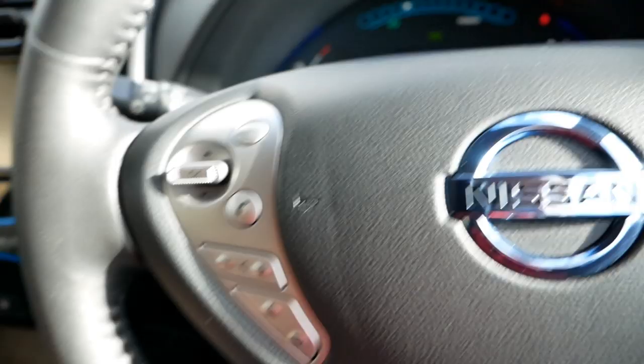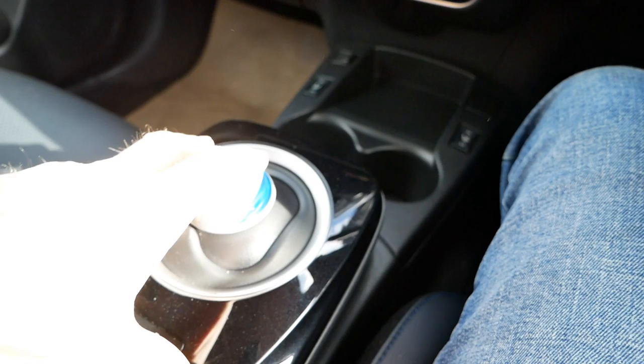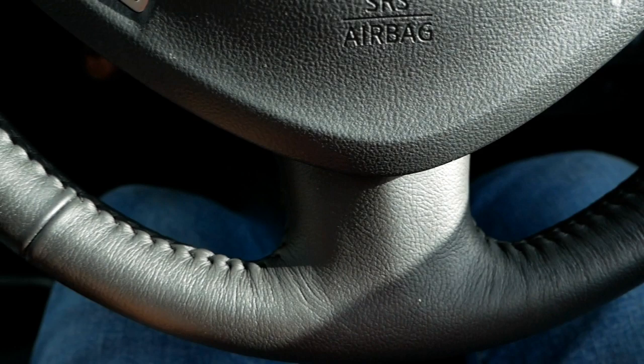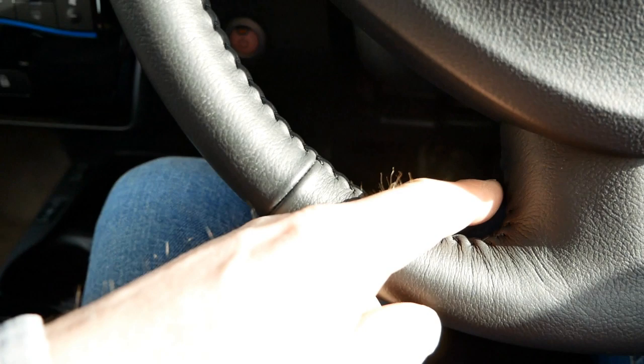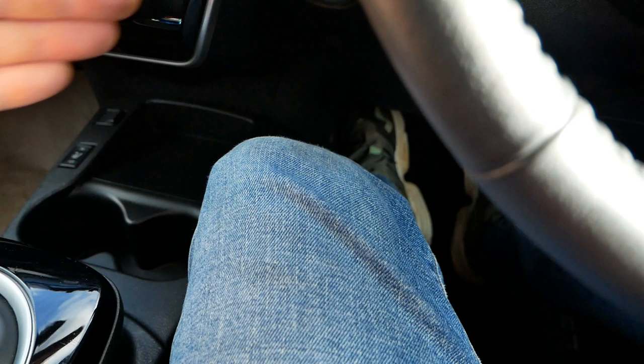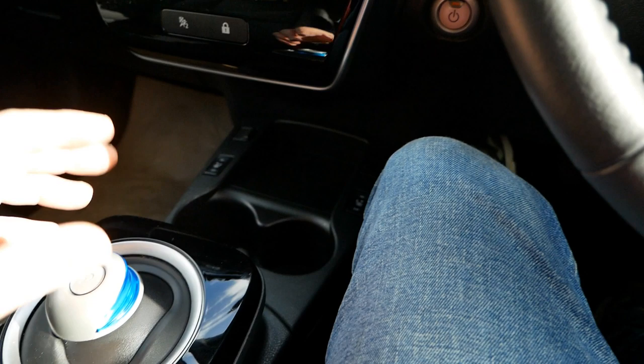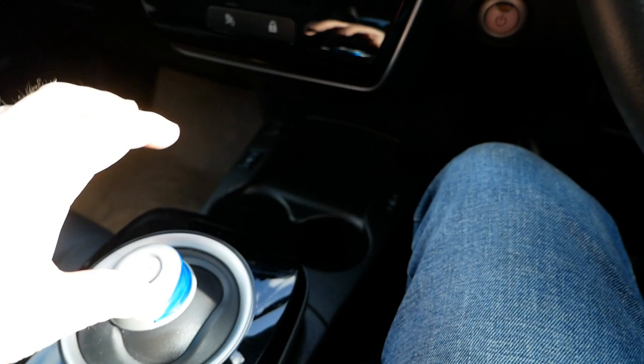When you come to stop the car and want to put it in park, always keep your foot on the foot brake while changing gear. Put your foot on the foot brake, press park, then apply the parking brake — and then let go of the normal brakes. That way the weight of the car is held by the brakes rather than by the transmission. Particularly on a slope, you always want the weight of the car held by the brakes, not by the park and the transmission.